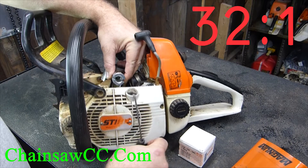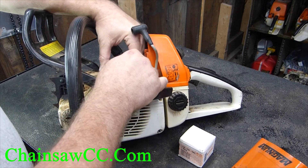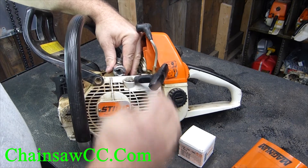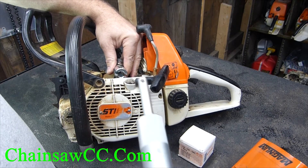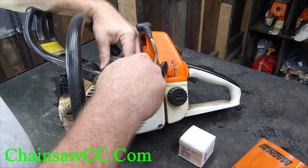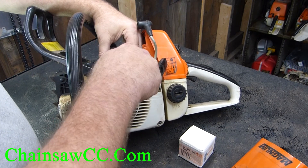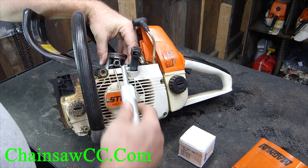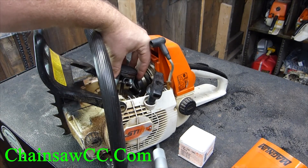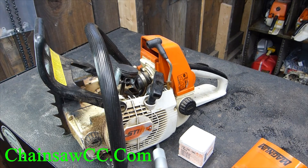Trying to keep the recoil out of the way of the picture. Get it lined up, then take the large tool — again flat side matched up with flat side. Get everything lined up and just push it home. That's really all there is to it. It sets it exactly the perfect depth. Not easy to see, but if you're not trying to film it, you can do it in about five seconds.